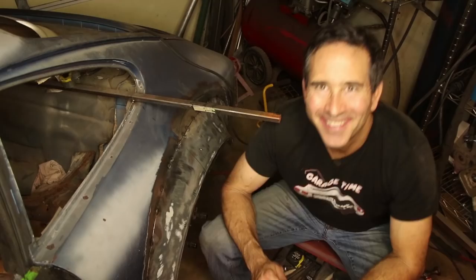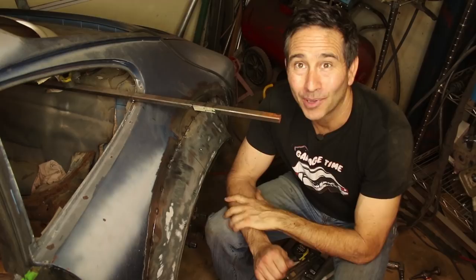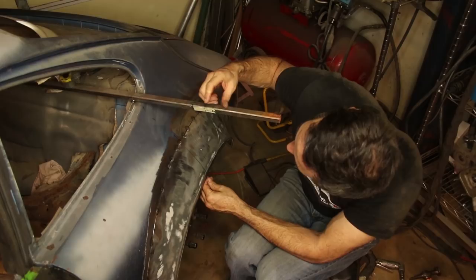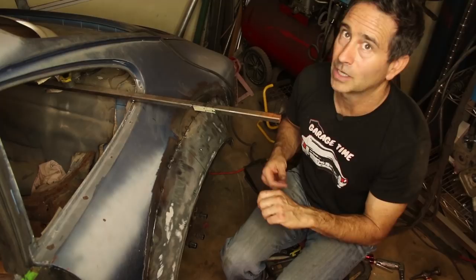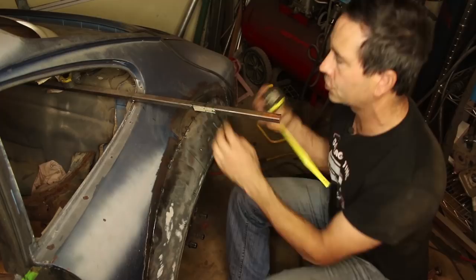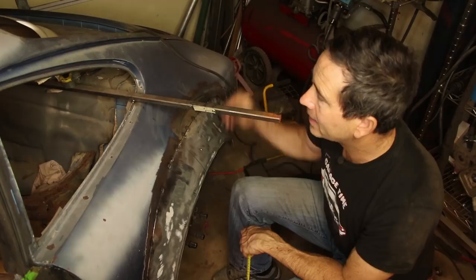It's just a little bit after lunch now and I have everything trimmed and gapped and tacked in place. From the front torsion bar hole all the way back to the bumper, it is now in its final position. I'm going to do a final check that things didn't move too much. The in-and-out position from the wheel is good and it's the same as the other side. The rear end is sitting about a quarter of an inch higher on this side than the other, but it's not throwing off the distance very much. The height is 226, which is exactly what it was with the old flare. So this position is correct, the line is correct, it's centered — basically right where I want it to be. I'm really excited. Now I can get this bar out of my way before I impale myself.